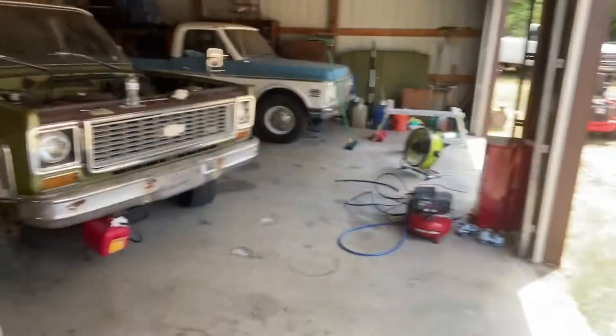I think I'm going to take that exhaust manifold loose — I think it's got a bolt broken off in the cylinder head. I'll weld a nut to it, heat it up, get that out of there and try to get it sealed up. Squeaking belts, exhaust leaks, and mismatched tires — I just can't deal with them. I've got to fix it.